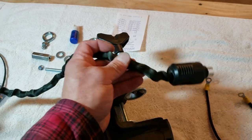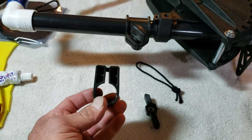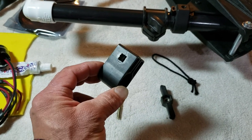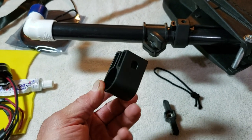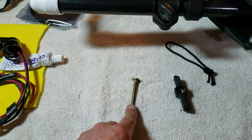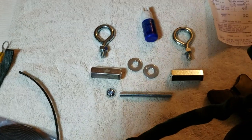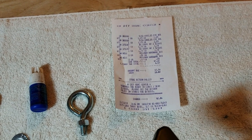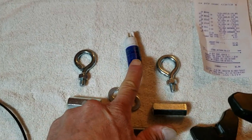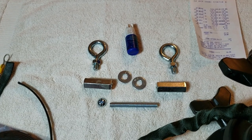Now, back to the Yakima snap-around bracket. You can buy these from Yakima — a set of four is about $20 — but if you have an outdoor store nearby that sells Yakima, there's a good chance they have one in a box they'll give you or sell for five bucks or less. Single bracket: about $5. It comes with quarter-20 hardware, but that hole is big enough for 5/16ths all day long. All the hardware here is 5/16ths. I bought it at my local home improvement store for less than $8 — $7.94 for this group of parts. I have some Loctite ready; there's one place on either side where I'll recommend it.